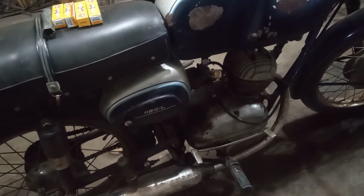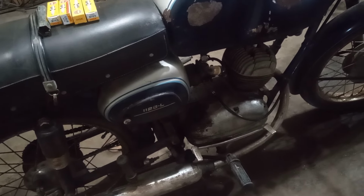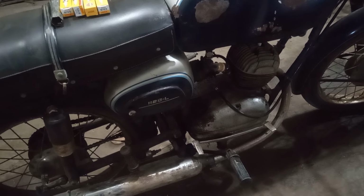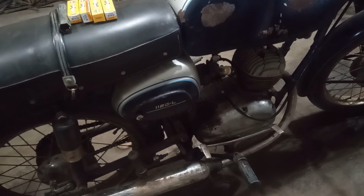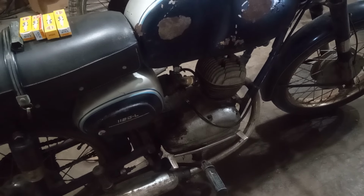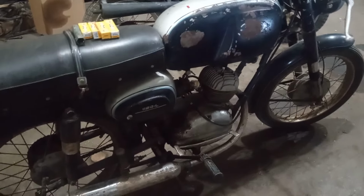Well, I was going to say the wrong side, but it isn't the wrong side. A lot of bikes used to run it on the right-hand side. But if you're used to a regular shift, it screws you up. And then being heel-toe, and then the pattern is reversed. It's one down or one up to get low gear. So you hit on that back part of the pedal. That'll get you in low gear. Well, he was trying to take off the other day, and by God, he was in third before he could figure it out. So he kept going down. That don't do it.